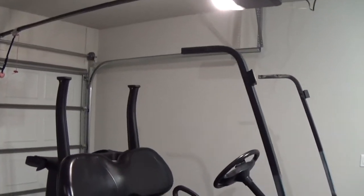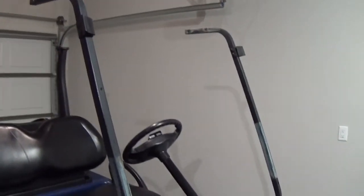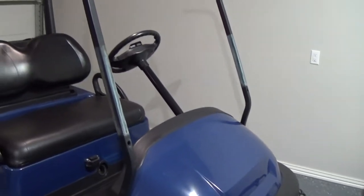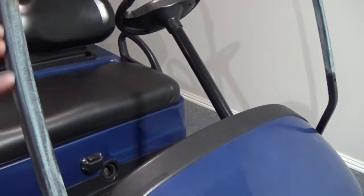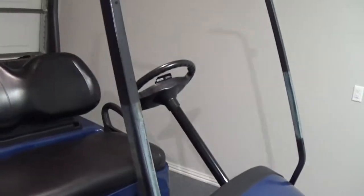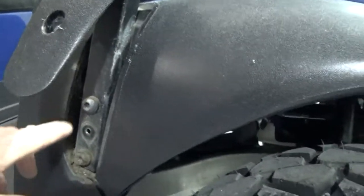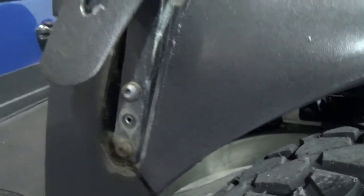We've got the roof removed and are about to do the upper strut arms, but the biggest battle was removing the windshield. That thing was stuck on there like Dolly Parton's wig and gave me a bunch of grief — I just had to keep working it with my thumbs. There's a clip that holds it on and just two bolts on the bottom. Next, I'll remove this plastic bolt cap, and underneath here are our Torx head bolts which remove our upper strut arms for the roof.